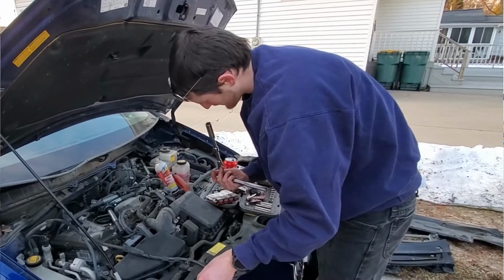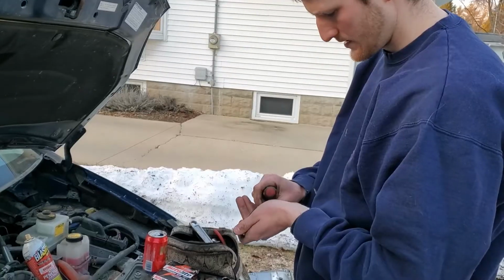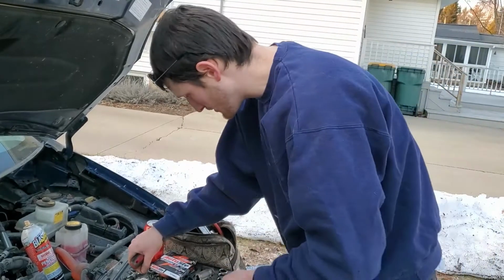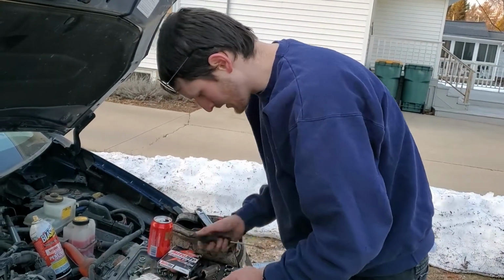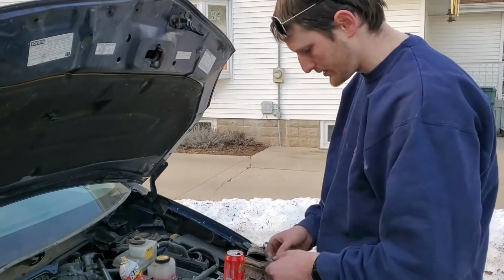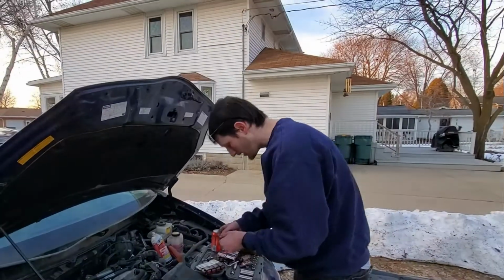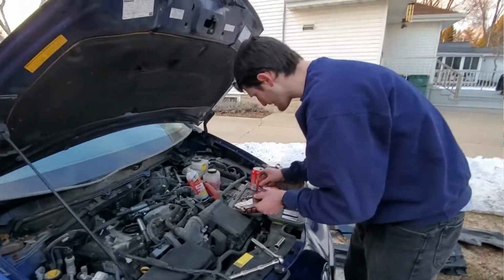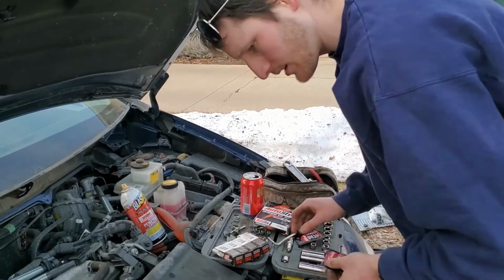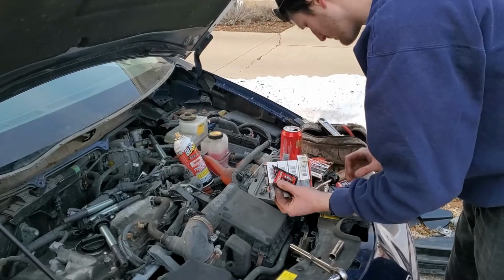Make sure my magnet's still in there. Take your magnet out, and put your new ones in. Now this is the part where having anti-seize is important, and it'd be important if someone didn't take your anti-seize. So you get your anti-seize opened up, and this is the ghetto way of anti-seizing. And you take your new spark plugs. Let's put the new ones. The new one right there.